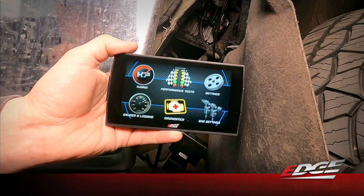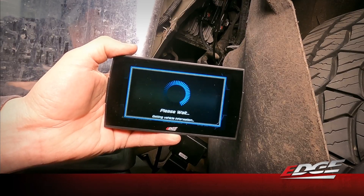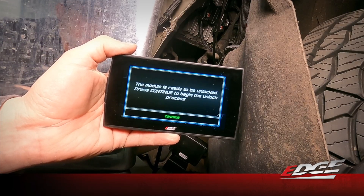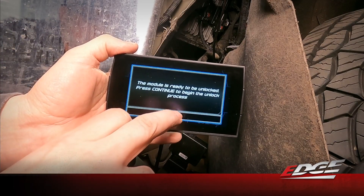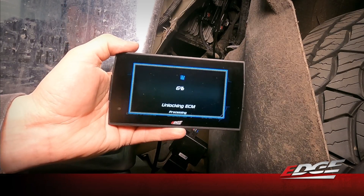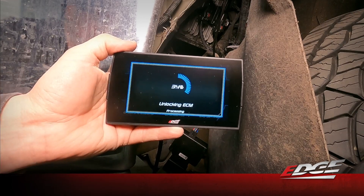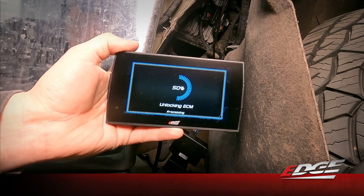We're obviously not plugged into the OBD2 port in the cab, so it's getting power from the battery connection through the locksmith itself. We'll skip this message and go back into our tuning menu. It's pulling vehicle data to confirm we're on the same truck. You may hear the relay inside the locksmith clicking a couple of times — that tells you everything is connected. It tells us the module is ready to be unlocked; press continue to start the process. You'll hear that relay clicking in the locksmith as it does what it's supposed to. Now it's going to walk through the unlock process, which will take five to ten minutes or so. We'll turn the camera off and pick up when we reach the final state of the unlock.